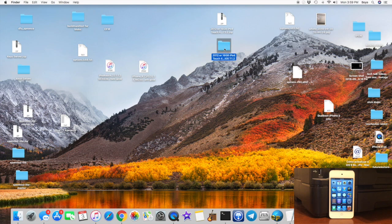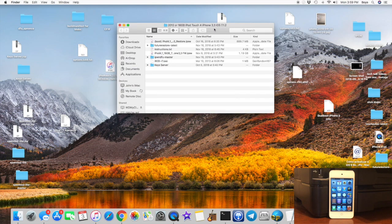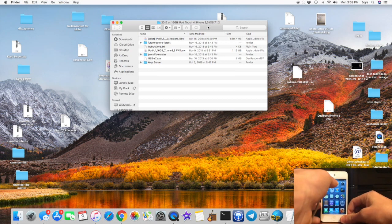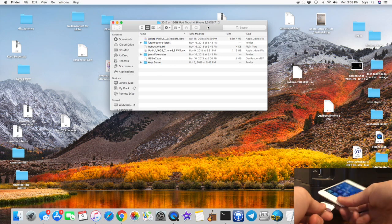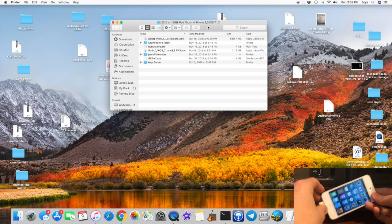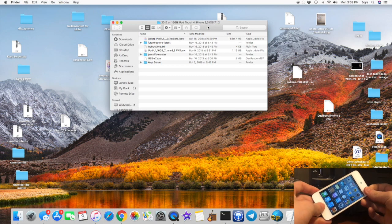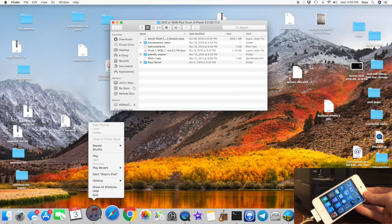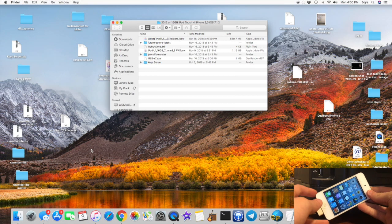Here's the folder right here. Once you get the folder, it should look exactly like this. Now we need to go ahead and plug your iPod Touch in and put it into DFU mode if you have not already done so. Go ahead and plug it in just like this. To put it into DFU mode, you need to hold the Home and Power button for 10 seconds, then continue holding just the Home button until it connects to your computer. Go ahead and close out iTunes if it is trying to sync.